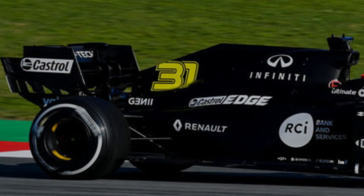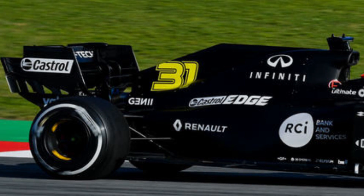The final thing to comment on is the rear wing. It looks a little more aggressive than last year — if you look at the end plate and just past the actual wing section, you'll see the cutout is a lot more aggressive than on a lot of other teams. Renault did try this last year but there was more of a curve; now it looks very 90 degrees down and straight across — very aggressive. I quite like the look of it. The end plate as a whole looks a little more complicated with a few more aerodynamic flicks, just to help improve the flow and the performance of the rear wing. There's definitely been some development there.